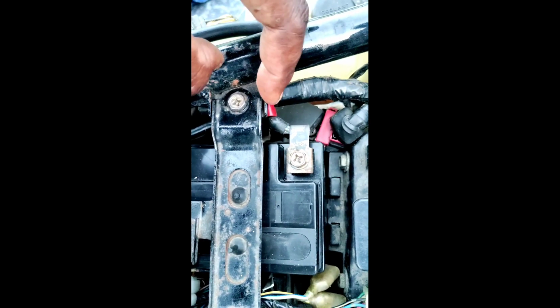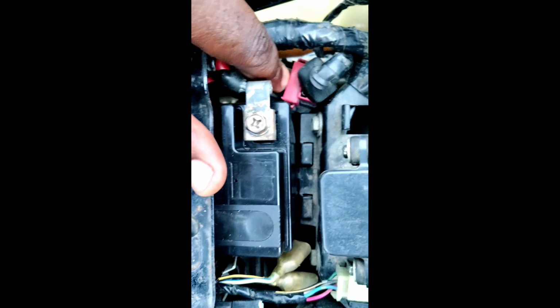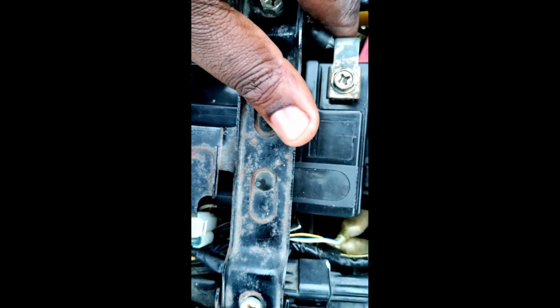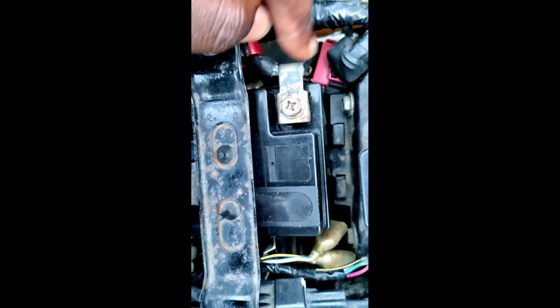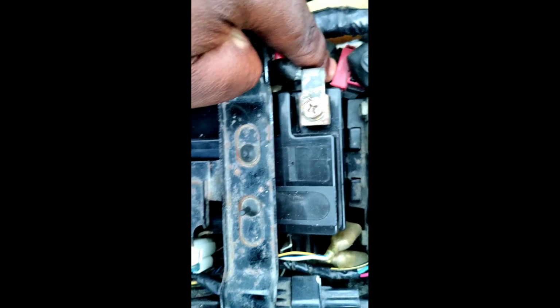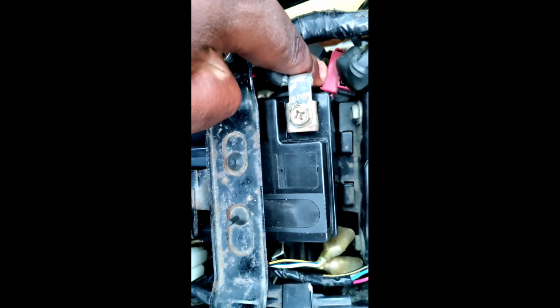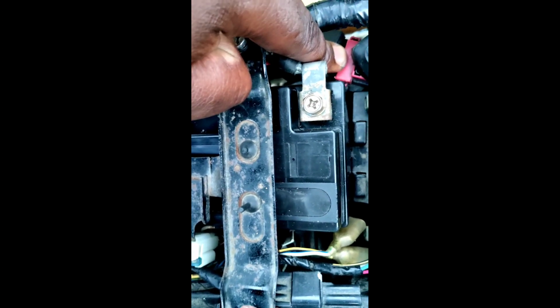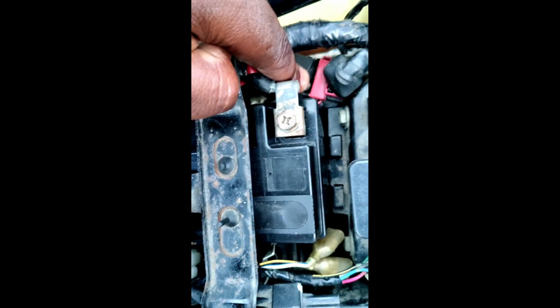This is my red side, positive. It's gonna be right down here next to where the positive side. You see that little red box right here? If this battery was out, you could even see on this little red box thing right here, positive side, follow that wire down, it'll say fuse, okay? You'll take that off and you'll see that 30 amp fuse right under here, okay? Take that out, replace that fuse, and in most cases your motorcycle should start right up, okay?